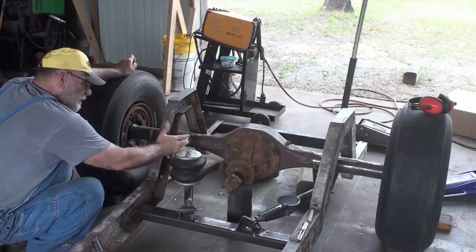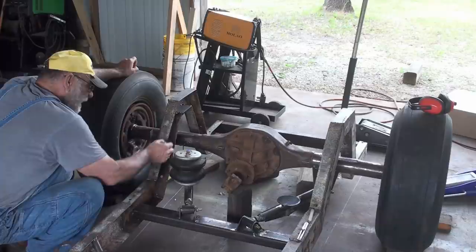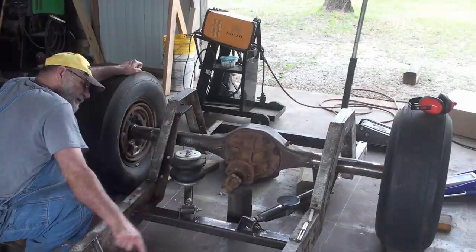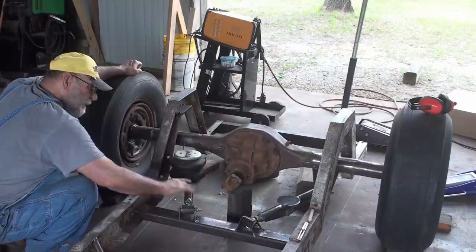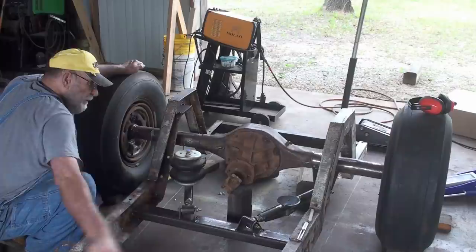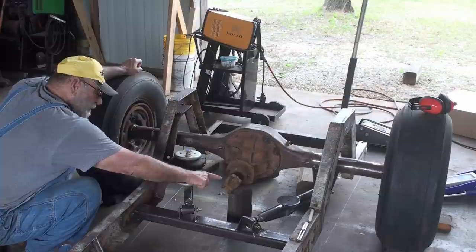Now I've got to build the ears and get the top links mounted. That's going to be the part you really need to pay attention to, because I'm going to show you how — with the top links — how to make sure your rear end yoke is pointing straight at the driveshaft, straight at the back of the transmission, when you let it all the way down and when you come all the way up. When you let it all the way down the rear end needs to turn down a little bit; when you raise it all the way up it needs to come up a little bit, so it's always pointing straight at the tail end of the transmission. This top link is the key to making that work.